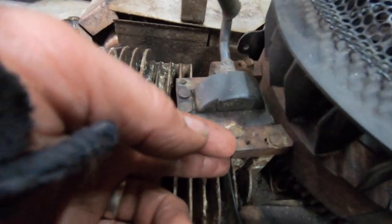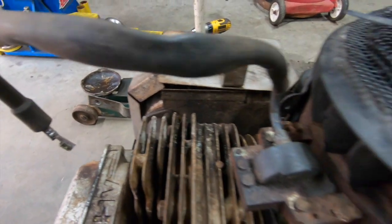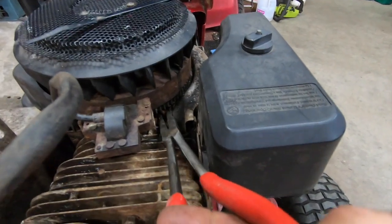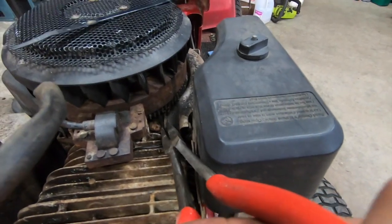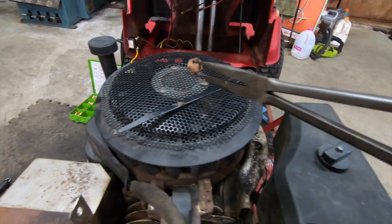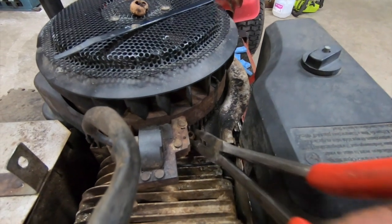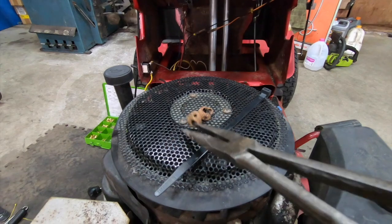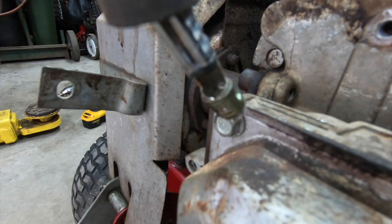Perfect. This is a headlight. This goes up completely unprotected. You know what? I might slide some, I always call it conduit, slide some wire loom over there. For right now, I'm gonna go fishing here. See what kind of prizes we got in here. There's always a prize. See? Couple mouse eating hickory nuts. Okay, I don't even need a test light the way this thing's facing. Hopefully the bungee cord's got the brake pulled in far enough.